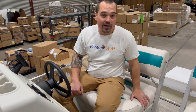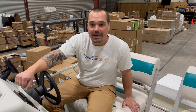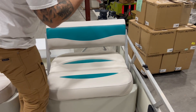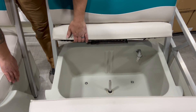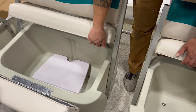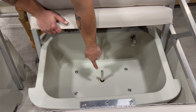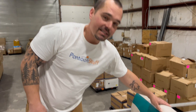The last switch runs a livewell pump — it's a bilge pump wired in and mounted on the back of the pontoon, and it feeds into this flip-flop seat. If you look inside, these flip-flop seats are set up differently: one is mainly just for storage and could be a cooler with a drain plug in it, but on this one we were able to install a drain for a livewell. We have our fill right here, and on the back side you can see how they work.